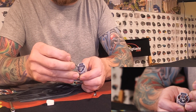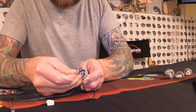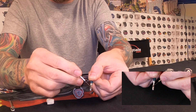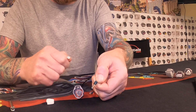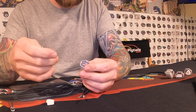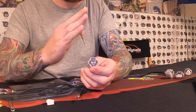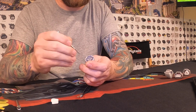Let's try this again — slide right down on top of the pin. Lift up the catch, then pull that pin out. It's catching right here on top of the pin; there's a little cutout, and all pins will have it. Sometimes it catches on the top, sometimes on the back side of the pin — it depends on how the connector is set up. When reinstalling, most connectors won't let you put the pin in the wrong way, so just make sure you match the right color wire to the correct cavity number.